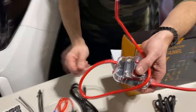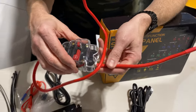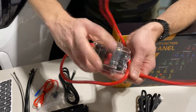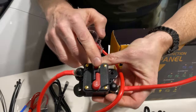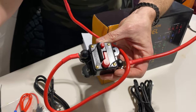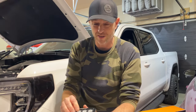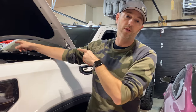On the positive terminals there's a 60-amp circuit breaker — this goes somewhere in the engine bay within a certain distance of the battery, and if you have a problem it'll trip and you can reset it easily. Now that I have eight things I can control, I guess I'm going to have to go get a whole bunch more accessories to show installs for on the channel. So without further ado, let's get into the install and hook up this light bar with the DRL, the spot lamp, and my onboard compressor.